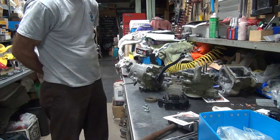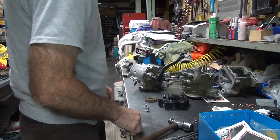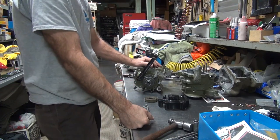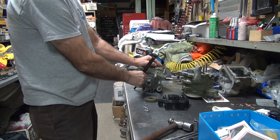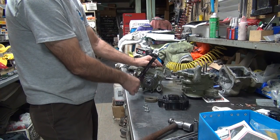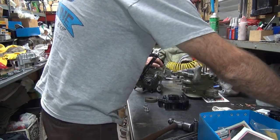Do we get your nuts for the bottom yet? Yeah. I think they're at home. Yeah, I think there's other stuff. There should be a kicker bolt on there. There's two or three different kicker bolts. They go on these depending on the year. The early one had the thin head on the one side, so it doesn't bang into the cover. Early ones had a thicker head, and the late ones have a steel bolt head on it. Differences on them.